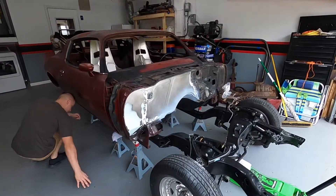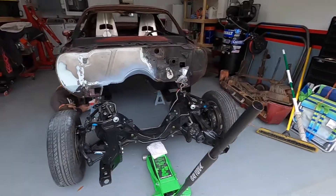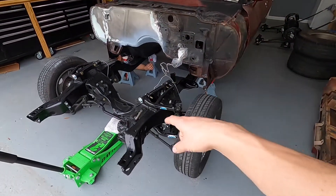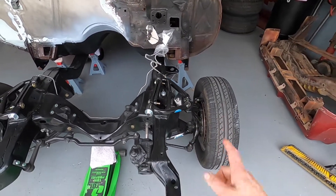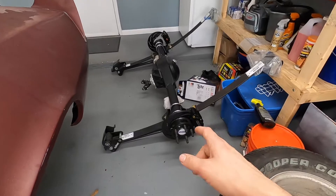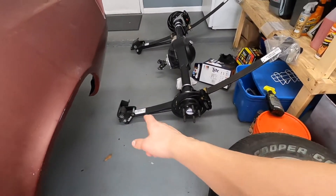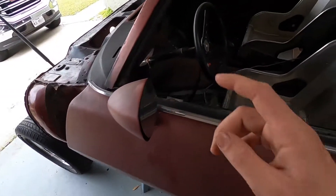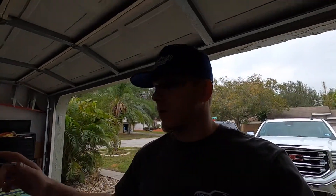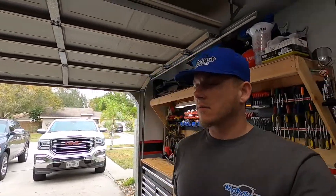For those of you who don't know, this is our '78 Camaro - our drag car project. It's not really a drag car; it's going to be a street car, but hopefully an eight-second or faster car. We got our subframe off - it's fully restored with upper and lower tubular control arms, Wilwood brakes, our Strange nine inch with 3.70 gears, a spool, race brakes, Calvert Racing mono leafs, and our CalTrac system. We got lightweight Kirkey seats in there. Once we get this together, we'll send the car off to the fab shop to get an 8.50 cert cage installed.